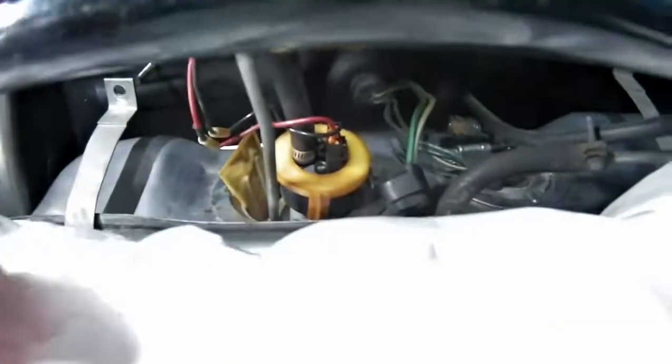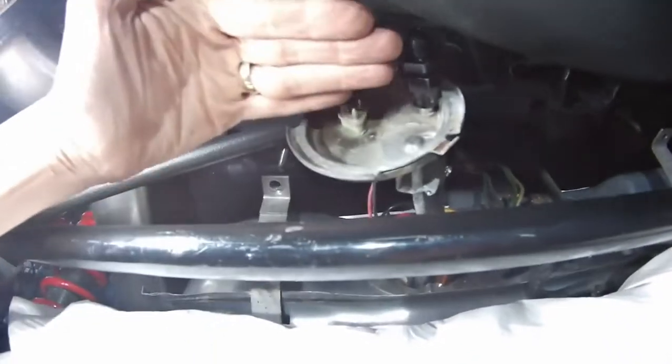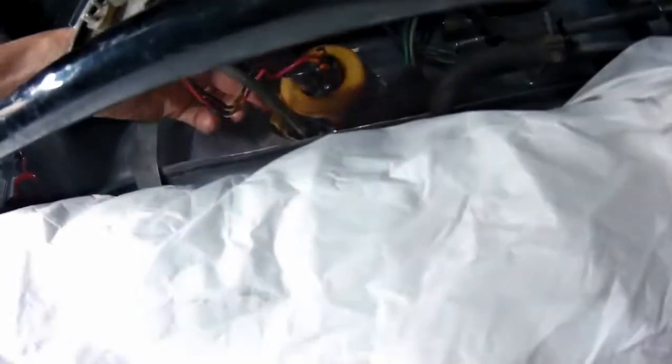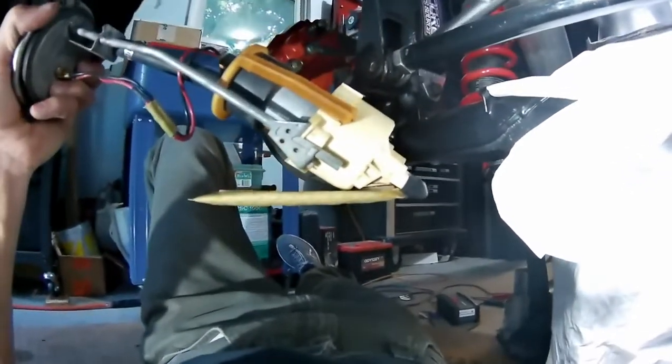Another tip — if you're pulling your fuel pump out, note that I've turned this 90 degrees to get it up and out. I've also dropped the tank — it's no longer sitting up there, I've got a jack under it holding it in place. It's easier if you rotate it, and then make sure you get in there and grab that fuel sock. Because when you take it out, that sock will pull away from the pump, and you'll be fighting to get the pump out unless you wreck the sock. So just keep in mind that if the pump's not coming out, it might be your fuel sock that's the culprit.